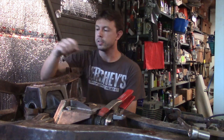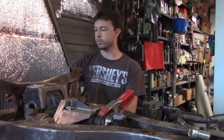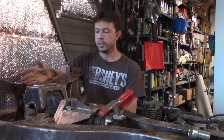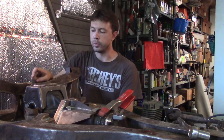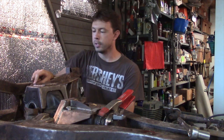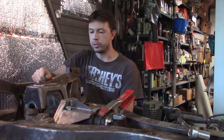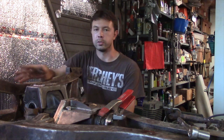The last thing required to get this differential mounted in here is a new cover plate on the rear with relocated mounting bosses to go under the Spitfire frame, and it's also much lower profile than the original in order to get the axles in the right position lengthwise. I actually made an entire rear cover and had all that on film before I discovered it wouldn't fit because it stuck out too far. I was so annoyed at having to do all that over again from scratch that I basically just didn't record any of it.